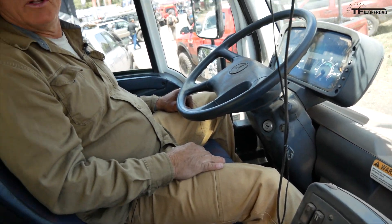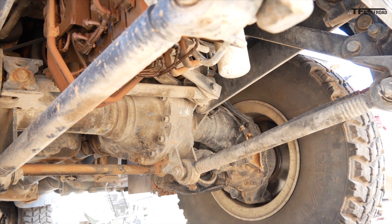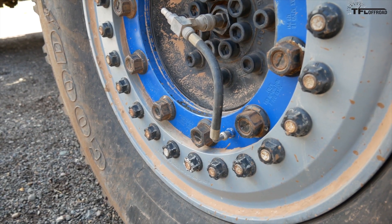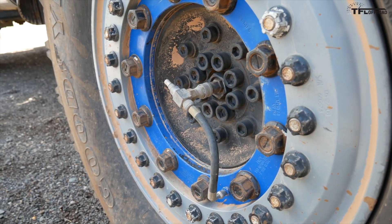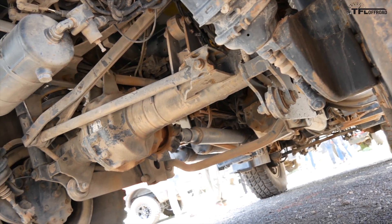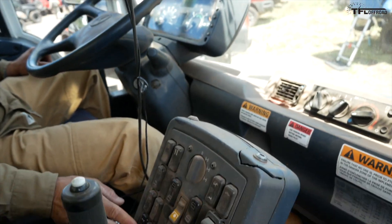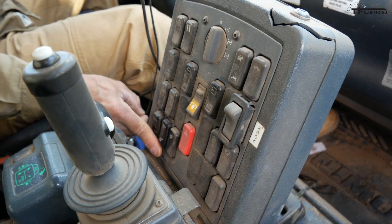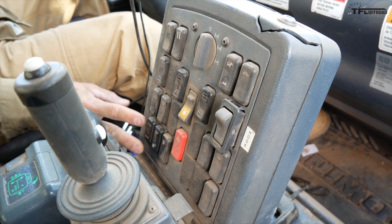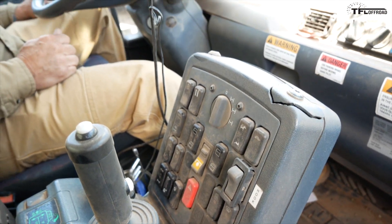You're kind of sitting on the steering axle, aren't you? Yeah, the wheels are pretty much right below us. It does have air ride seats to help take out some of the ugly out of the trail. It also has central tire inflation. On the fly as I'm going down the interstate and pull off onto a dirt road, with the flip of a switch I can go from my road pressure of 60–100 psi and drop it down to 25–30 psi for off-road. Right here I can select front axle, rear axle, air up, air down — I can air up or air down both front and rear simultaneously, or do one axle at a time for finite adjustment based on the weight I'm carrying.